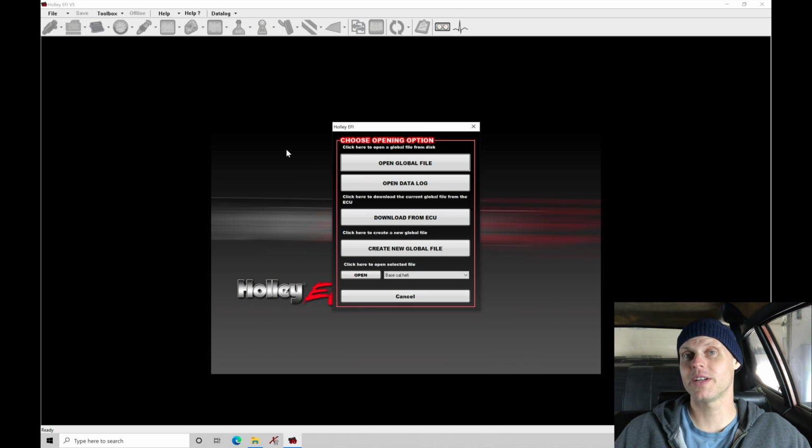Welcome back to the live training session here with our LS Swap Nova. In our last video, we created our base map. This video, we're going to learn how to upload this base map to the Dominator box and get the engine to fire up and run. Now, our goal here is to tweak the idle control, fuel and spark timing so the engine can maintain and hold its own idle, so that we can move on into the next video, taking a look at the part throttle cruise area of operation and calibration.